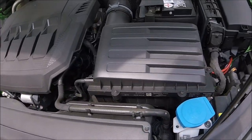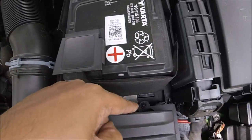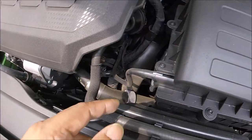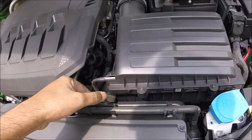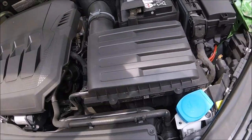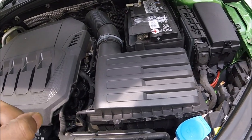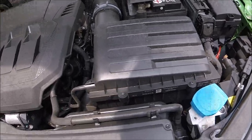So to remove the intake, you need to remove eight screws. Then this whole unit will come off and you can access the filter. Lift up the filter and pull out the snow grate from under the filter. I'll put the camera somewhere so we can see it and move on from there.